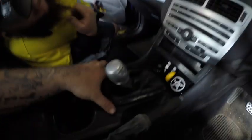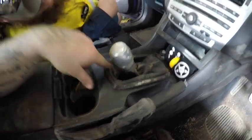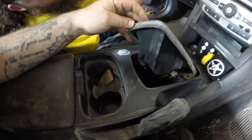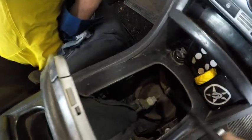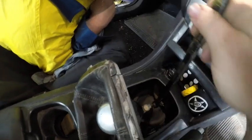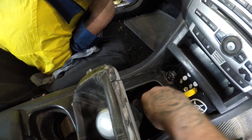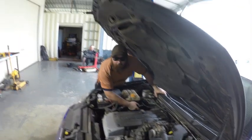Step one - we're going to do it in steps for you amateurs. This little tricky dicky - it's really not that tricky. A lot of people get a screwdriver under there but that's not the way. You literally push down and grab the back and pop it up. I've already popped this one, no broken clips, we're all good. Then you've got two 13s down in here, take them off and that's your shifter off.